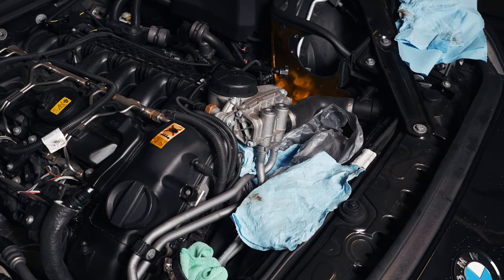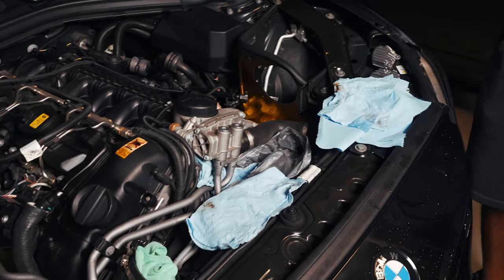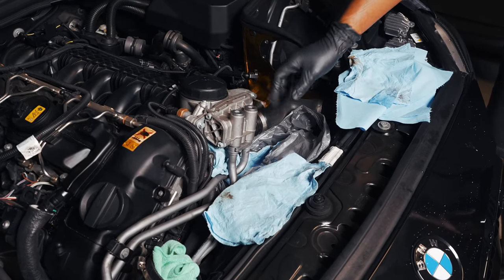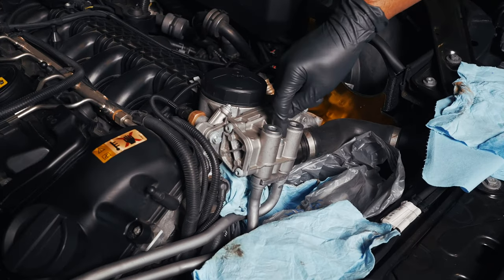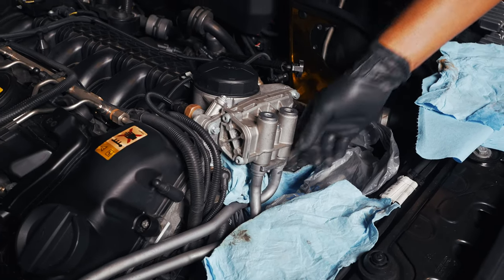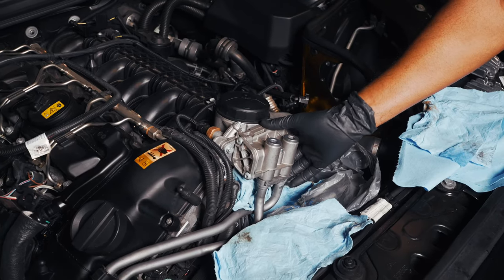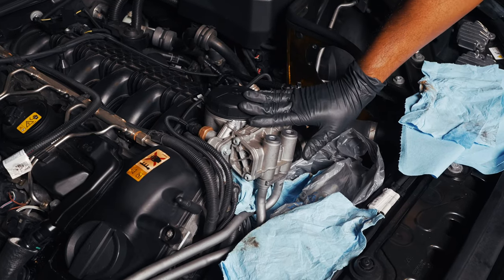Before we go ahead and remove the stock oil thermostat, you're probably going to wonder why we have so many rugs — it's because this is going to get a little bit messy. To prevent any oil spilling onto the belts in the engine, I went ahead and lined it with a few rugs and plastic bags. The removal process is pretty straightforward: the center top bolt is holding the oil lines in place; when we take this out we'll wiggle the oil lines down, then remove the three E12 bolts — one, two, and three — and after that it's just a matter of pulling the oil thermostat off, cleaning everything up, installing the new gaskets, and putting the new oil thermostat on.